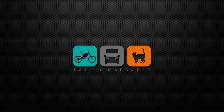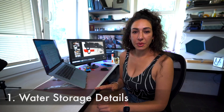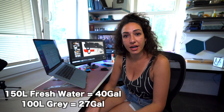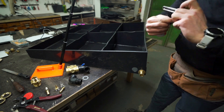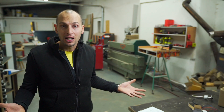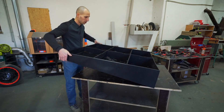We knew we wanted to have two underslung tanks, so our fresh water and our gray water are mounted underneath our van. A lot of people will avoid putting their fresh water under the van because of the fear of freezing. Our workaround was to install in both tanks a small heating element — this does not heat up the water for your shower, it just keeps it a few degrees warmer than freezing. We decided to make these custom-shaped so it does nothing to our clearance — it kind of fits up there like a jigsaw piece.